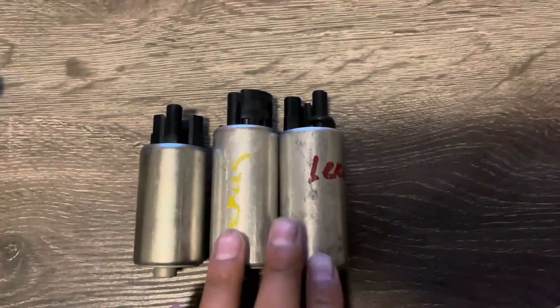This is a short video for you guys who are getting ready to install your LC500 pump. I don't think anyone's going to have an issue with the car sitting without fuel in the line, because there's usually still fuel in the fuel rail. Even if you don't have that check valve and fuel is going back into the tank, all you have to do is double-tap into accessory mode and wait two or three seconds so it can fully prime. I already have a member who tuned with that pump without the check valve and he had no issues, and his fueling improved a little bit.